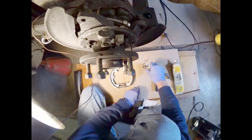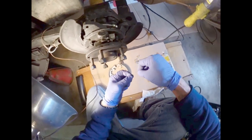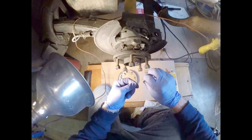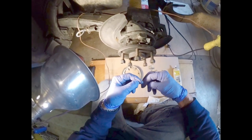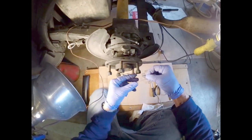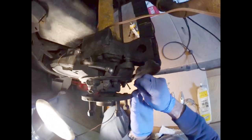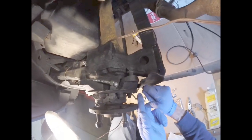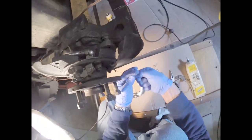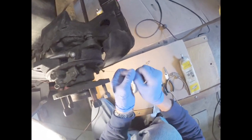Now there's a little preparation. Let's prepare the captive pin. To do that, we'll put a little loop in this wire — like so — and put it on that captive pin. There's the wire, and we'll be threading that through the hole of the brake shoe.